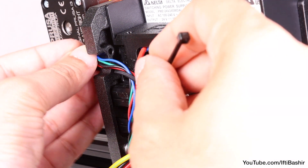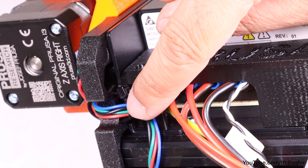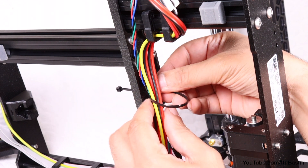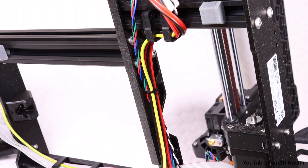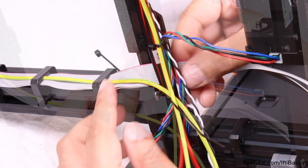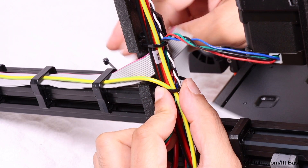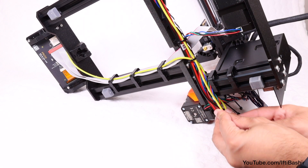Sticking with the underside and specifically the Z-axis right motor cable, insert a zip tie through the holes in the frame and proceed to close the end very loosely to create a loop. Tighten the zip tie — no need to go super tight, just enough to keep the motor cable nicely tucked under the frame. Continue downwards and using another zip tie, create the next loop in the frame, guiding the Z-axis cable and all cables from the PSU through the zip tie, trying to place the PE and power cables at the bottom of the bundle. Continue guiding the cables along the frame and towards the electronics board, this time including the Y motor right cable into the bundle, and secure with another zip tie. Carefully guide and fold the LCD ribbon cable under the cable bundle without adding it in for now — leave it free. Include the PE cable in with the existing bundle and secure the cable bundle with a zip tie before bringing it across and up towards the electronics board.